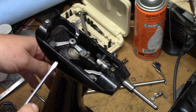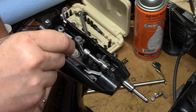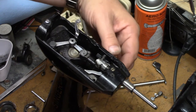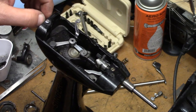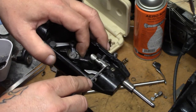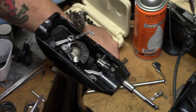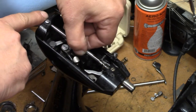To remove the needle bar, you have to have the needle bar in the full down position. Behind the needle bar there's a hole, which is your access hole. You'll insert your screwdriver, find the screw head, loosen the screw, and that will free up the needle bar. In some cases, you might have to remove this needle bar adjustment gauge before you can actually get the needle bar out. So I've got the needle bar loose, I'm popping the gauge off — that's nice and slimy — and just slide the needle bar up into the little divot on the top.